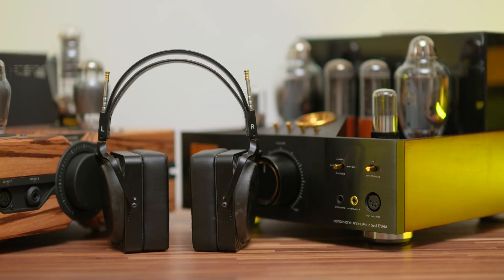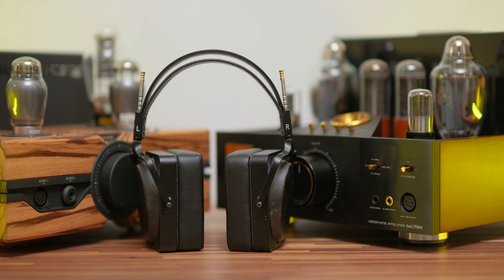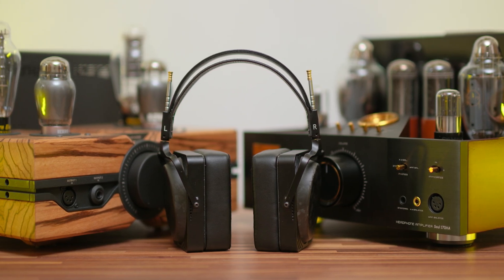These can be fun and punchy sounding — just make sure to send a couple of watts from your amplifier to their drivers, and they will start sounding much nicer. These can also be polite and quite mellow on some entry-level and low-power devices, but once you start pumping lots of power, these basically transform into something else, into something dynamic once you pump lots of current into their drivers. Except for their understated look and higher than usual weight, I have a much bigger concern: their low impedance of 11 ohms and also their low sensitivity of 90 dB. While on paper it doesn't seem that scary, once you start playing with them you realize that these are very power-hungry headphones.